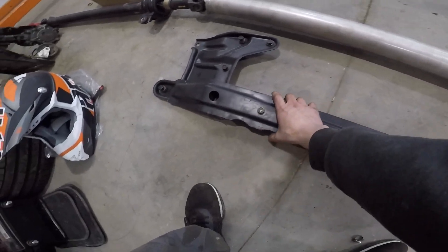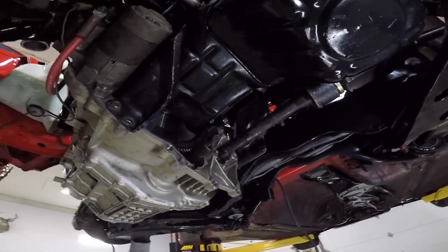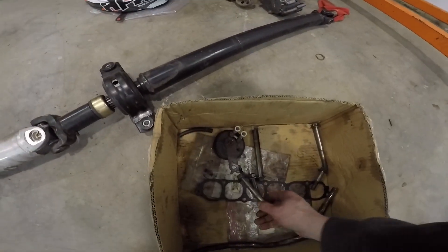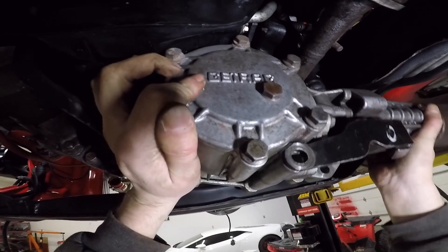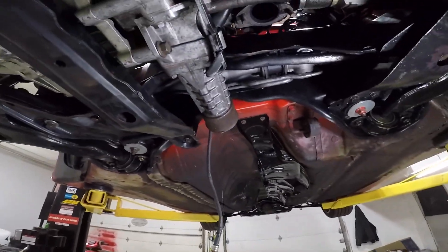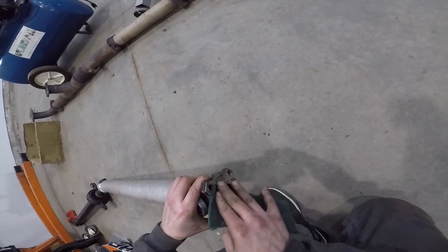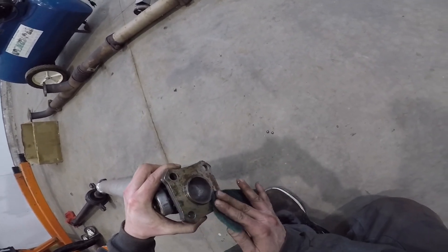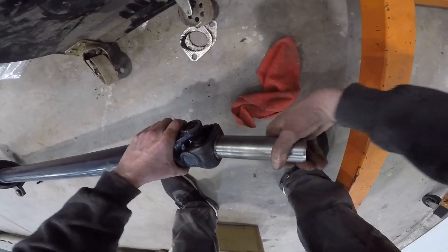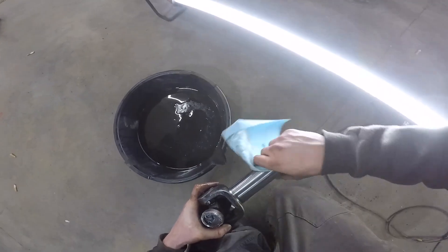Let's get this crossmember on, then transfer case, driveshaft, and exhaust. Got the crossmember in. Transfer case is gonna hook onto these splines right here and then these bolts — three long ones, two short ones — and then your transfer case, which is made of glass so be careful. These are 22 foot-pounds per the manual, so torque these at 22. Now the driveshaft — I've got the two-piece aluminum. This flash rust thing right here probably wouldn't be a problem, but I'm using some oil on a green Brillo pad just to get this surface rust off. You want to make sure this mates up flat. Just get a couple drops of gear fluid from the transfer case and rub it on the yoke — you want this lubed up real nice when you put it in.